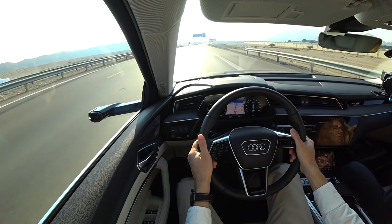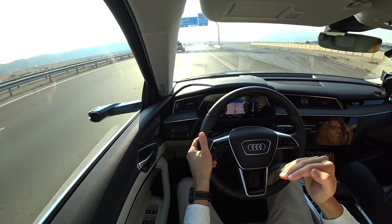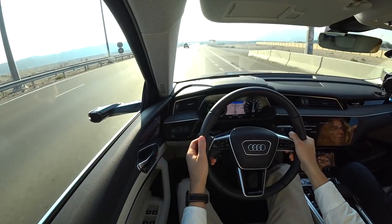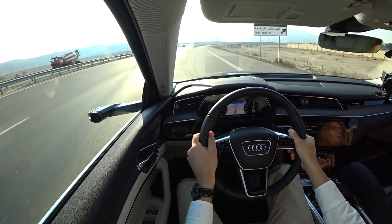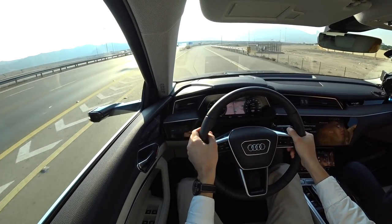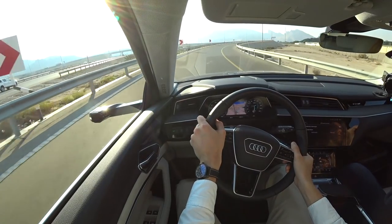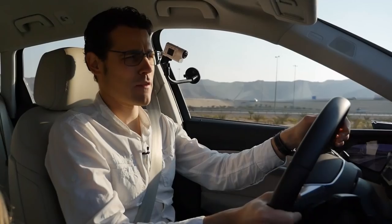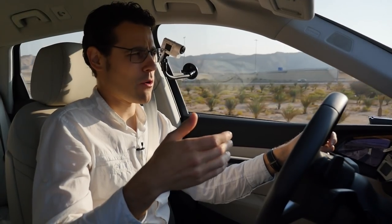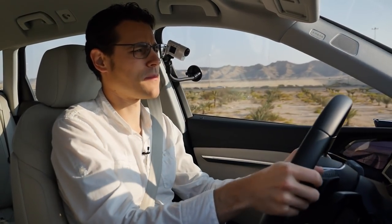And there you can set the first recuperation mode, and then also when I hit the throttle again, it stays in this mode and goes back to reducing the speed as soon as I go off the throttle. And also the second recuperation mode, and that one would be coming closer to this one pedal feeling or driving. So I think this automatic mode they did for customers who are used to driving normal petrol engine cars, maybe. However, if you go off the throttle there, then you also don't have rolling, you know. You also have some engine brake, unless you have a modern automatic system which also uses these rolling or coasting effects.